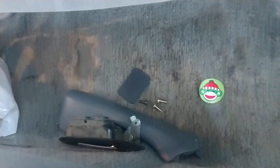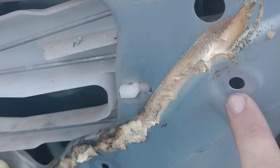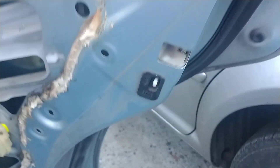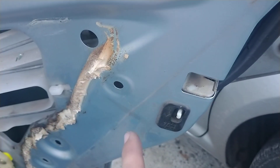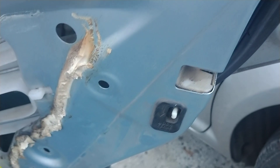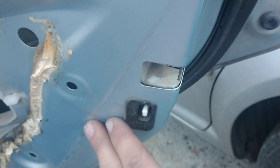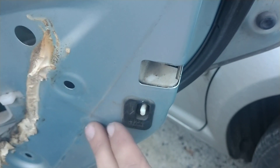There will be a screw in here and a screw at the bottom — Phillips head, all screws. Those two are the golden screws, and that is the plastic cover. Then lift the door panel off — it's held in with generic Honda push tabs all the way up and down. One of them can feel like another screw but just needs a little pop. Use a trim tool to pop the door free, or a decent flathead screwdriver. Be careful with flatheads not to scratch any exposed paint, or you will see those scratches and eventually they will rust.